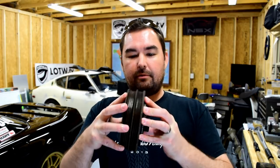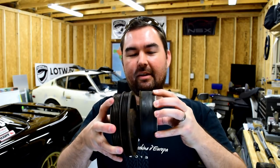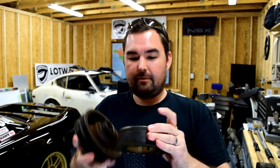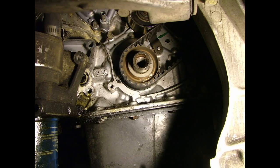Number two: crank pulley harmonic balancer separation. The failure point on this one I can demonstrate because it happened to me. This is the original crank pulley and damper from my car. What happens is that the harmonic damper — this big chunk of rubber with a metal backing on it — actually just separates from the crank pulley itself. What happens is this will continue to spin inside it, and on this side you're looking at the timing cover and then the timing belt. Because of its metallic ring, it has no trouble, in fairly short order, grinding its way through the timing cover and eventually the timing belt. If the damper ends up finding its way all the way through the timing cover and then either interferes with or snaps the timing belt, you're looking at probably a bunch of bent valves, if not worse.